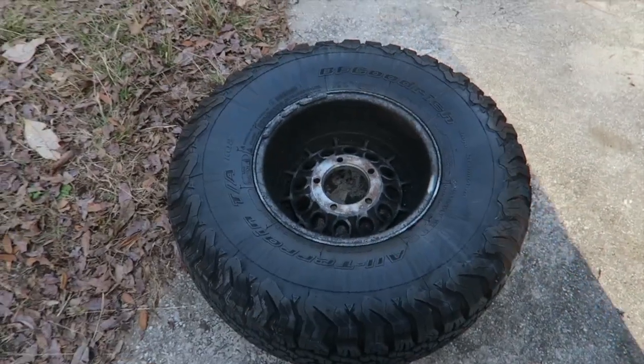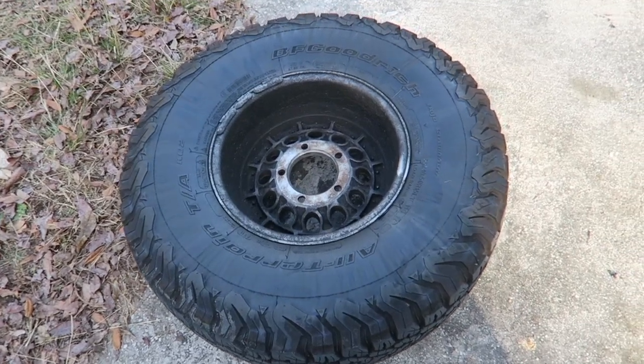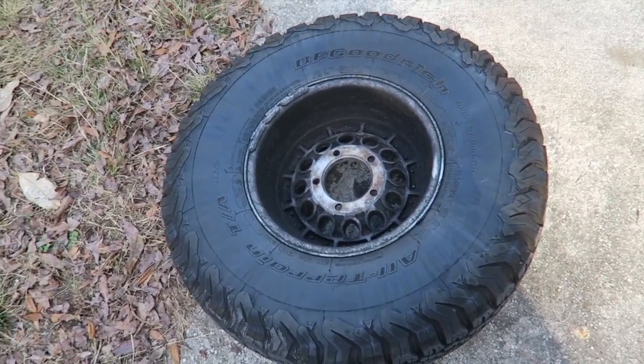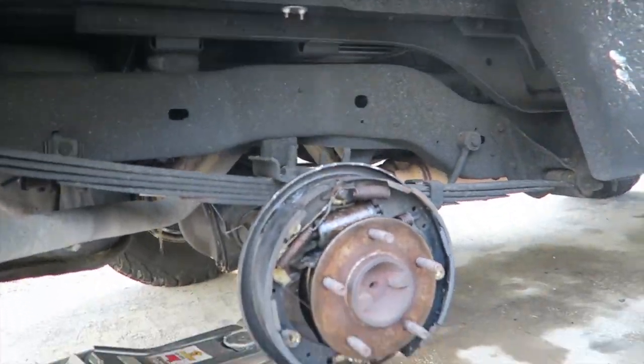You can tell by the back of the wheel - the rear wheel seal and bearing were leaking, getting differential oil all over the wheel well and the rear wheel. We'll have to get that fixed. A couple days later we're back to repair the damage to the axle. From what I gather, the axle seal came off, the bearing went dry, disintegrated, damaged the brakes, and probably damaged the axle.